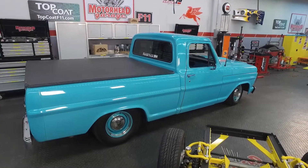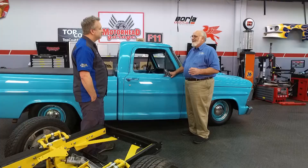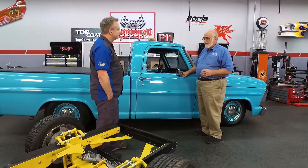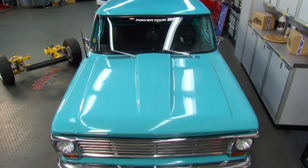This is a '67. You're talking early '80s when you got started. At what point did you start to realize these cars from the '60s and early '70s just didn't handle that well? From '48 or earlier, you've got to change the whole suspension. These are okay, but they're not up to today's standards — particularly the Ford Twin I-Beam. A great work truck suspension, really not a good 85-mile-an-hour suspension. A lot of geometry issues; there are a lot of limitations to a Twin I-Beam design.